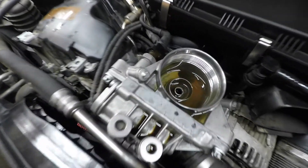I think what we might be experiencing is just leftover coolant in the engine from before, because once water mixes with oil and emulsifies it's really hard to get out. So I went to Home Depot and bought a couple jugs of cheap oil, and I'm going to do a couple of oil changes without an oil filter. I'll put some oil in, start it, and run it without any coolant in the system. Once we get decent oil, I'll add coolant back and see if anything is mixing.